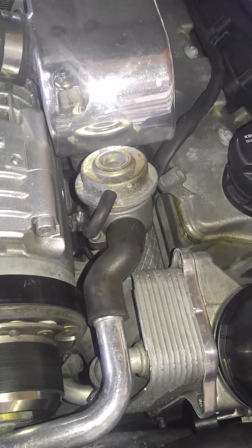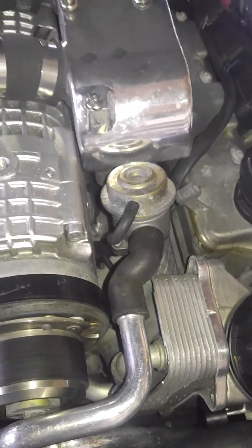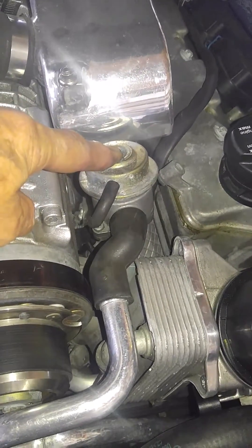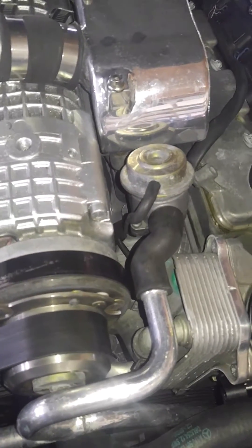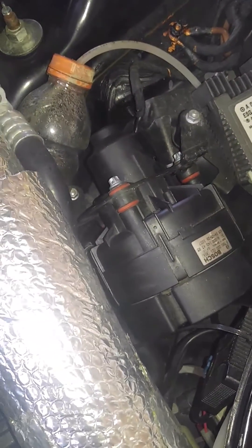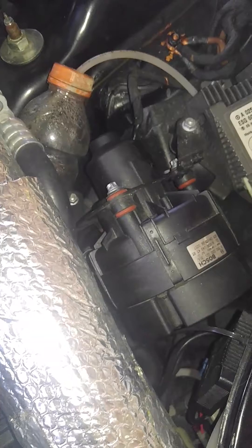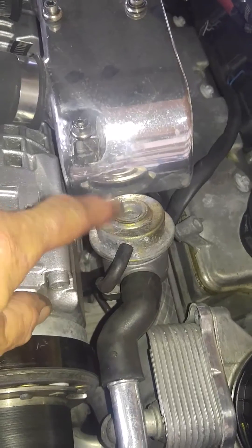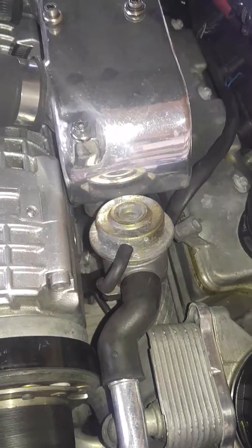I believe that's why my smog pump was running 22 amps of current — because the smog pot was not open. I might do an experiment: put a meter on the air pump again to see what the air pressure is in the morning when it starts up cold and the signal opens the smog pot. I suspect with these being open, the current draw is much smaller.